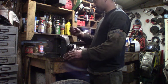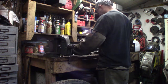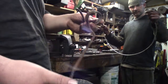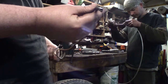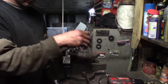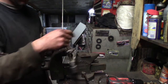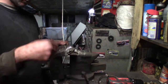New line — that's how it goes. You can see this would have gone up into the proportioning valve and it's real rusty right through here. Wayne actually found it leaking at the bottom, so we're going to go ahead and mimic this line. He's going to cut the old line off so we have fresh line and double flare it on there. Double flare — inversion flare. I wish it was bubble flare; bubbles are easier.